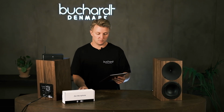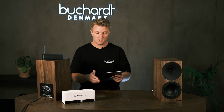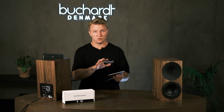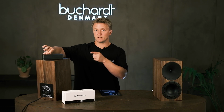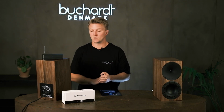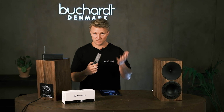You can also do that, but we need to pair the remote first to the Platin Hub, and that can be done also in two different ways. Within the app, you have a remote pairing. You can start there if you go into settings, but you can also press and hold the pairing button on the back for 3 seconds. 1, 2, 3, and the back LED on the Platin Hub will start to flash rapidly. And now you just need, if you of course have mounted the batteries, to press any button.